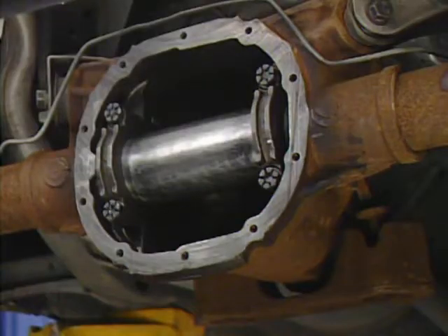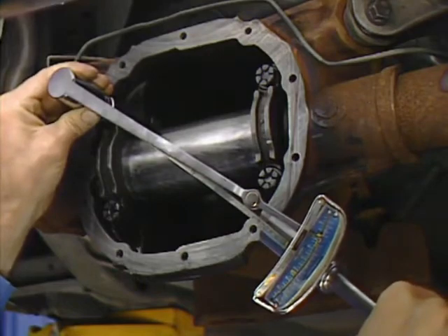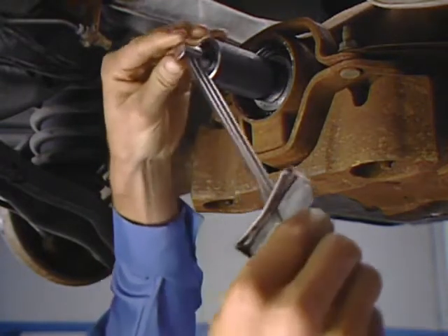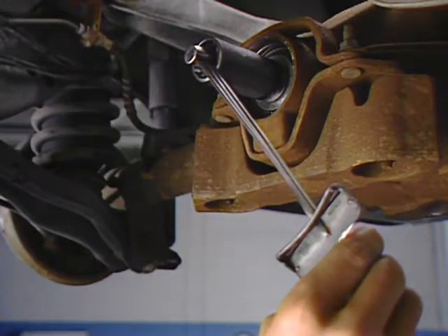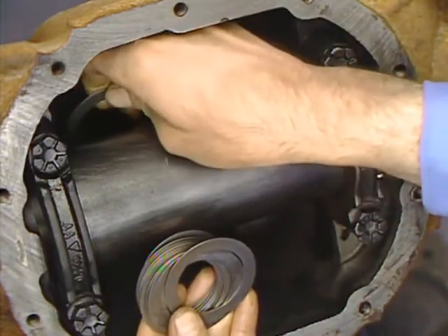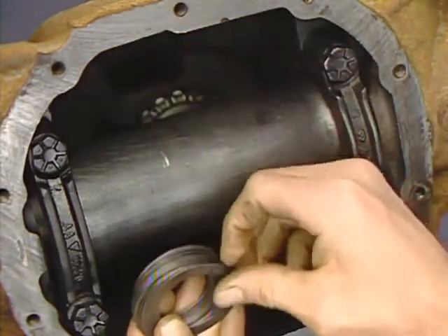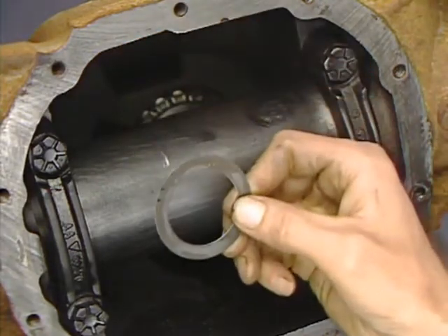Center the appropriate gauge tube in the differential bearing bore, install the bearing caps, and tighten the bolts to 70 to 85 foot-pounds of torque. Before checking for clearance, make sure the rotational torque of the handle is correct and that the gauge block is offset at the correct angle. If either of these is not correct, the wrong shim selection is likely to result. When the gauge block is properly positioned, use clean, flat, undamaged shims to gauge the distance between the gauge block and the tube. The correct shim will just fit with a very light drag. Don't attempt to force the shim between the block and tube — just a very light drag is desired. Anything else will result in choosing the wrong shim.